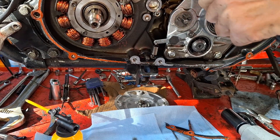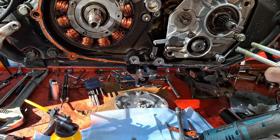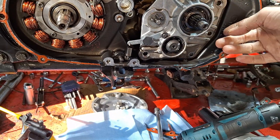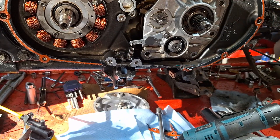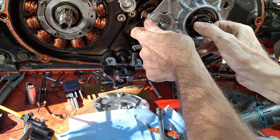I'm just going to use a half-inch socket on these. This goes all the way through the case with the right case half. Now, if it doesn't come right out, you can use a crow's foot under the edges here to pull it out. Let's see if I can actually get it out of here — oh yeah, it fell right out.